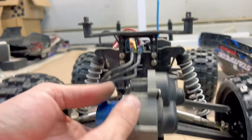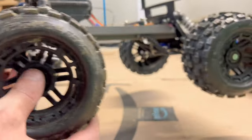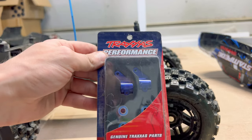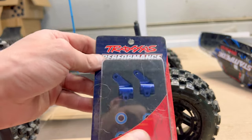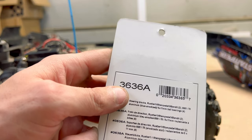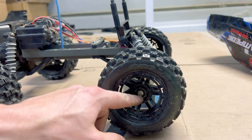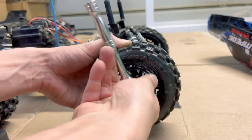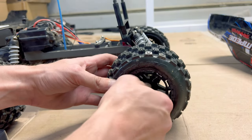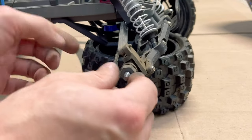I am back and I've got the back finished. We got both the new driveshafts on, got the hub carriers on, got it all tidied up. So it is time to move on to the front and replace the front steering carriers with these aluminum ones from Traxxas — part number 3636A. Just like taking off the rear wheel, the easiest way to take this off is to take off the 8mm rather than the 17mm wheel nut. So much easier.